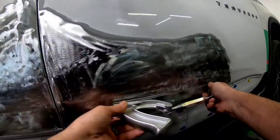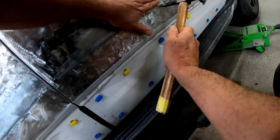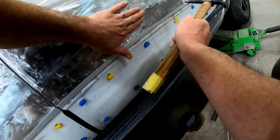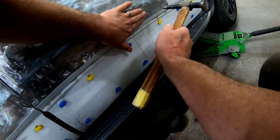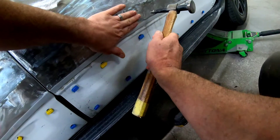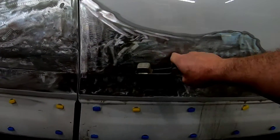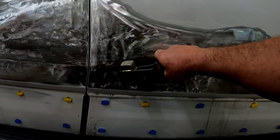You want the metal to be in a little bit from factory so you can put a thin coat of filler on it and then block it down level. If you have questions, leave them down in the comments below, and if you want to support the channel and find this content useful, like, subscribe, and leave me a howdy down in the comments. I'm pushing on the metal here and you can see how flexible it is, how it's giving — and that is not a good thing when you're applying body filler.